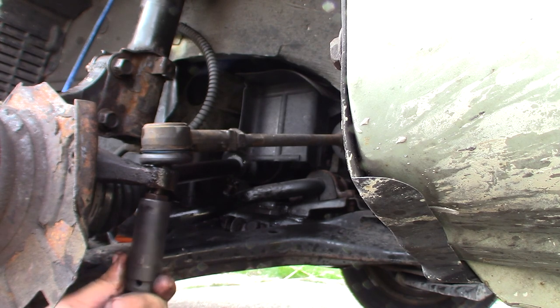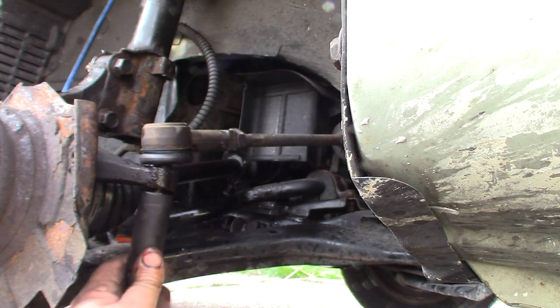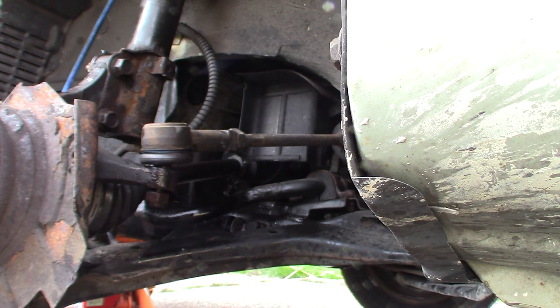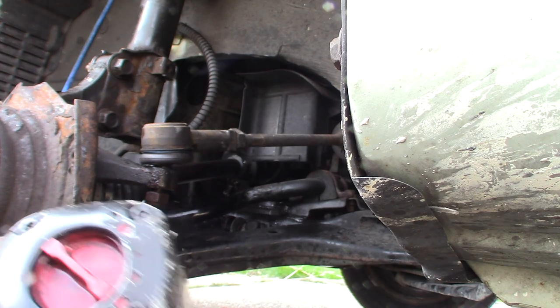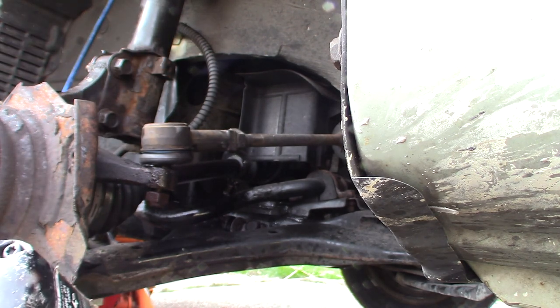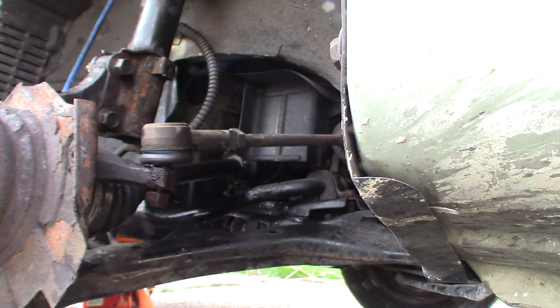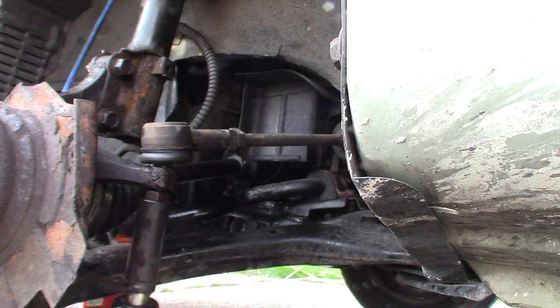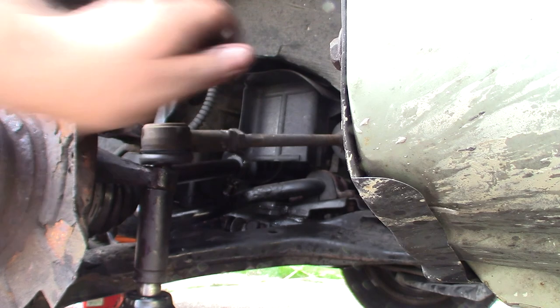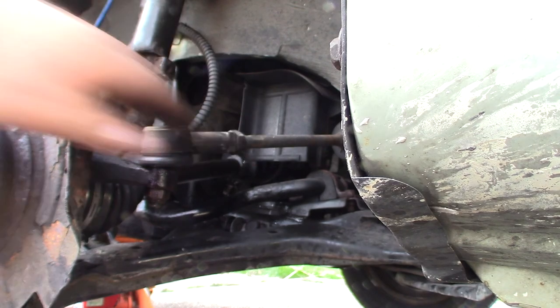And I like to normally put these on with hand tools. I just don't have a 19 3/8 out here handy at the moment, or an adapter. So I'm gonna hammer it on there with my impact. But I'm just gonna put my impact on its lowest setting, because you're putting a steel bolt into an aluminum knuckle, and you can overdo that and kind of mushroom out that knuckle, and then over time you're not going to be able to get it to seat in there tight anymore. So these don't take a ton of force. Just get them good and snug. That is perfectly good enough.